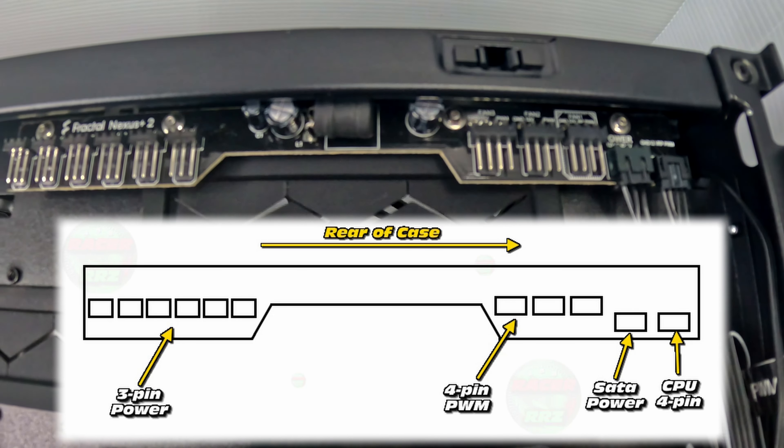Talking about CPU — wow, that's a little bit hefty, but we can also upgrade this if we were that way inclined. We can even upgrade the memory. Right now I've only got 64 gigabytes of DDR4 2400MHz ECC registered memory. We do have extra slots so we can totally expand this out further as storage capacity increases. We should aim for about one gigabyte of RAM per terabyte of storage, so we probably should be up at around 80 — but there is room for improvement.